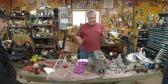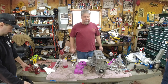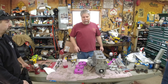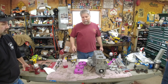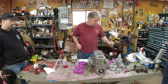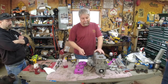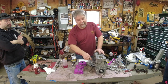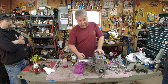All right, here's a little something I learned from my buddy Duct Tape Mike. I'm sure most of you guys watch Todd's channel and you saw the Storm RMK that Mike bought from me. After he rebuilt the motor, he had a bunch of problems, and they were taken apart in Todd's shop up north. Here's what Mike told me he thinks happened. He thinks he didn't get the cylinder base nuts tight. He was trying to be fancy and use a crow's foot wrench, and he thinks it was just wedging against the casting. And geez, there is not enough room in here for anything except the box end.